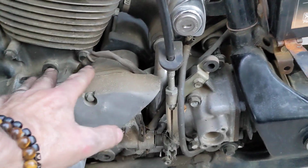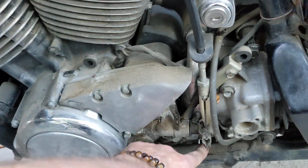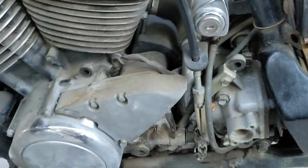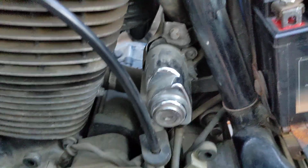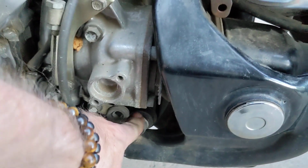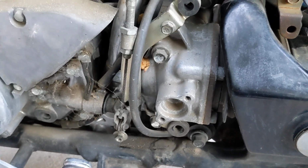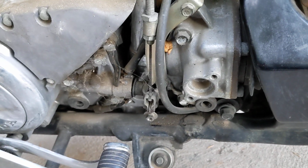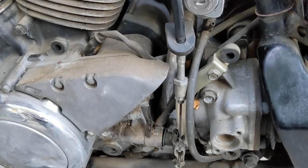On the other side, so you've got to remove the chrome cover, which is 2 clips that are kind of hiding on those, and 1 bolt at the bottom. Then it comes off a little bit like a side cover, and then you have access to the other end of those engine bolts, which you'll have to put a wrench on so they don't spin when you turn them. Torque them up to the right spec and in the right way, which involves a little bit of oil in the rubber, otherwise you'll get engine vibration.